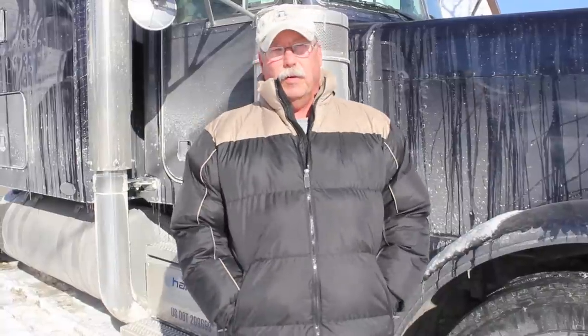There are some other tips you should follow when prepping your truck for cold weather operation. After you've fired the truck, you should check to make sure that the belts are spinning properly, that the alternator is charging, and that the air compressor is functioning properly, because all these things are affected by extreme cold.